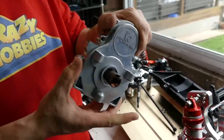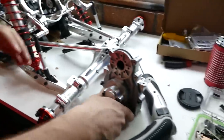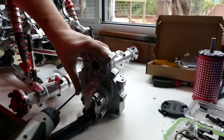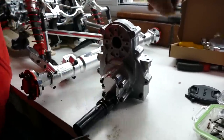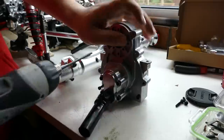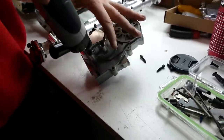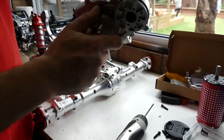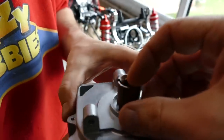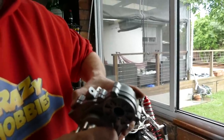Wow, look at that — it's huge. We need to separate these two plates, get inside there — another two screws. When we open it up we can see what grease is in there. It's definitely marine grease — I can see it, it's red. Inside the transfer case we have what looks like red marine grease. At least it's there — it does come with it from factory, and there's enough there too.